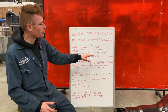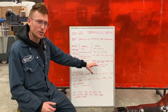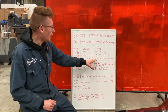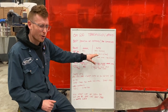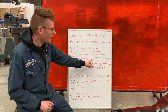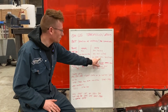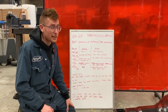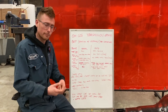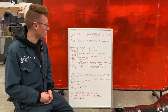If you want to go auto at 400 horsepower, it's a bit of a grey area. The big American autos are a bit overkill for 400, even though they're absolutely fine for it. The stock Mercedes stuff is not up to the job at 400 horsepower. The 722.6 will take it stock, but there are loads of problems with that gear controller and the electronic interface, so I'd stay away from those with a mechanical system.